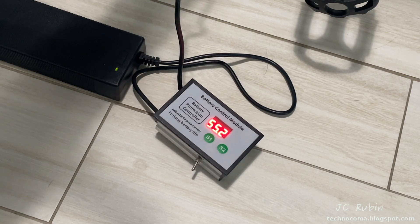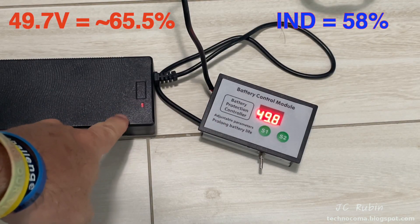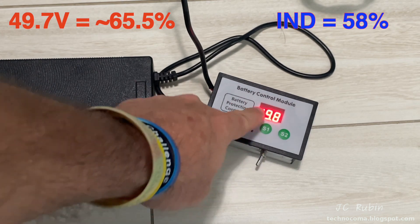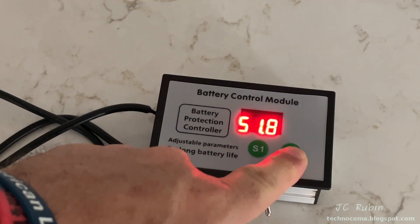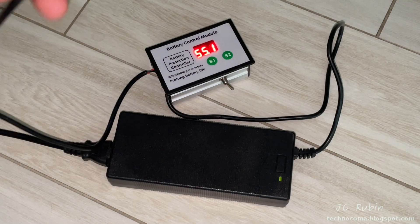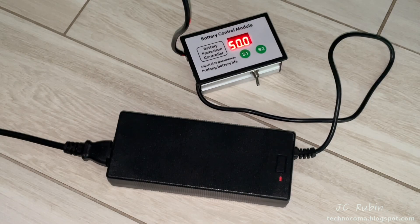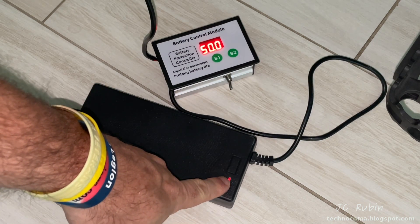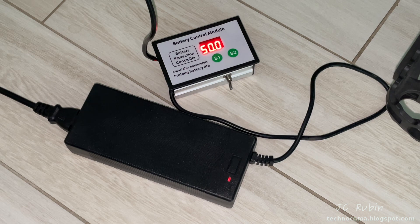With the switch set to bypass and the battery plugged in, it produces voltage immediately and all correct indications show on both displays. We can see 49.8 volts on the battery and the red indicator showing it's charging. Flipping to bypass it stays on since the battery was already showing voltage. Future testing confirmed this setting only gets me to 78%, so I adjust — 51.8 volts will get me to exactly 80% on my bike. I flip to bypass, plug in the battery, see the battery voltage, then flip over to the left to engage the cutoff. I note that the controller stops at one tenth of a volt above the programmed cutoff, so I'll watch for it to shut off just after hitting that point.